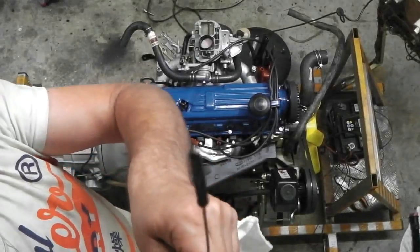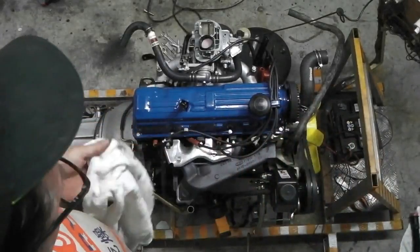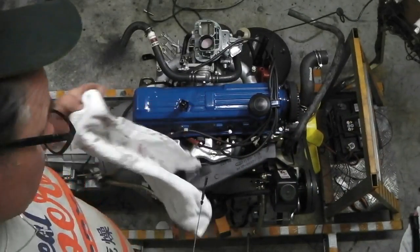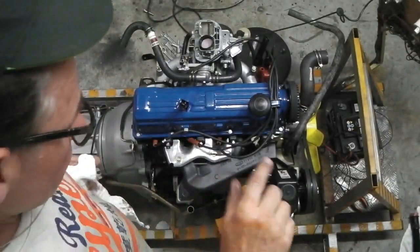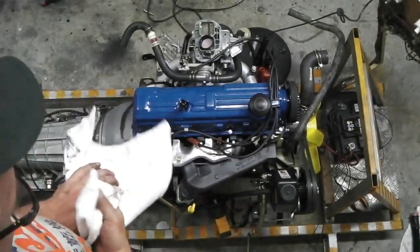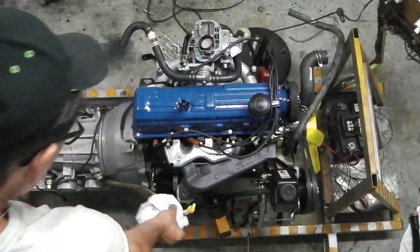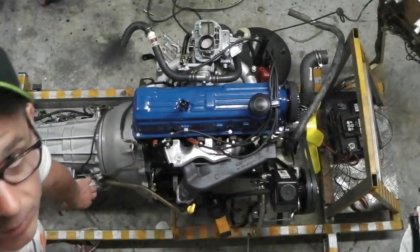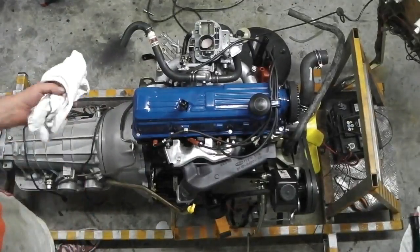Right, we are showing just above max on that, but it's got to take the fluid into the torque converter. It'll only do that when you actually start spinning it up. Alright, so we're okay, we're in the zone. We'll keep our eye on that level. There's our nice galvanized dipstick set up there. So we've got two pipes here which send the fluid round to the radiator.